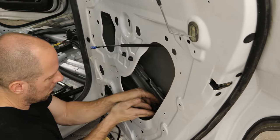Now we can put our A-pillar trim on. Plug in our speaker, slide the tabs into the dash, then clip in the little bracket that holds it from flying across the car when the airbags deploy, and clip it into the pillar. Pull our gasket out that's tucked behind it. We're going to do the same thing on the passenger side — clip in our speaker, clip it into the dash, put on the A-pillar leash, and clip the trim in.